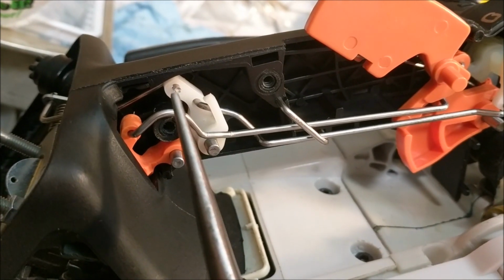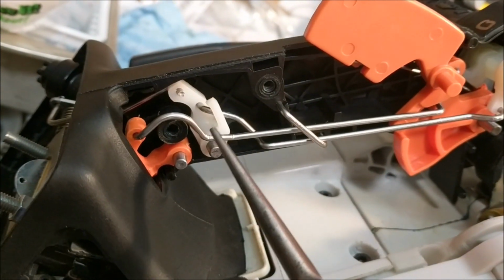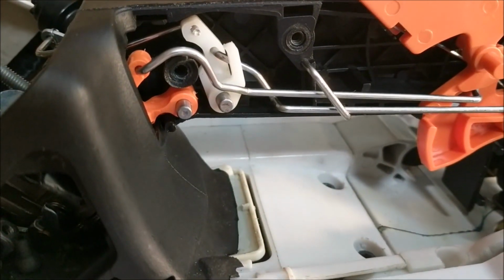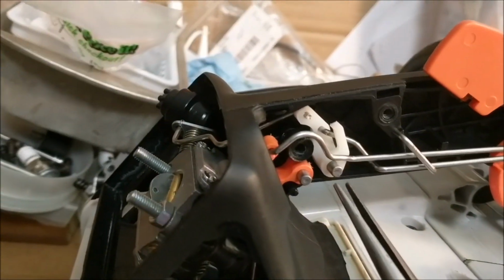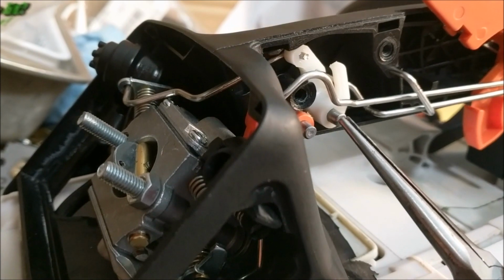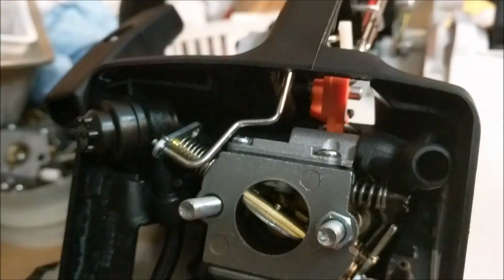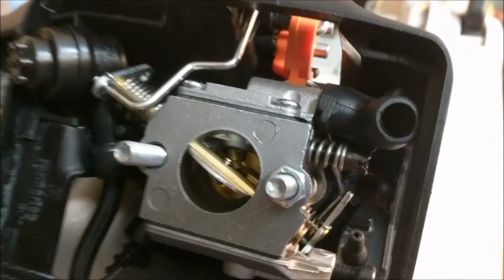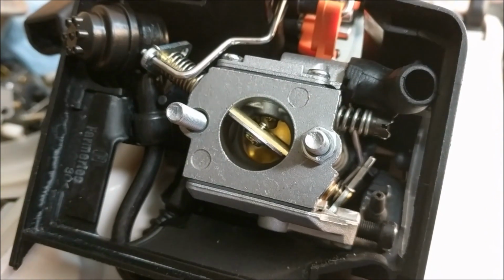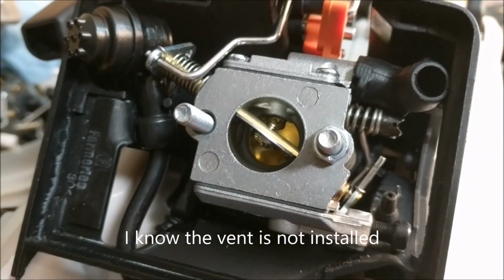even slowly, that rod right there will pop out of the double seat deal right there, the white one. It'll do it every time. Front side doesn't come out, doesn't affect it. I think, and I don't have any way of knowing this because I don't have anything to compare it to, but I think there's 2 problems. I think one, the bar is soft and may not be in the exact bend that it's supposed to be. And then the second thing is the carburetor.